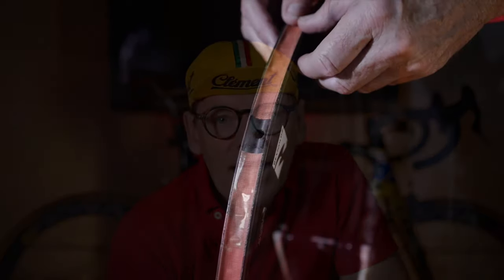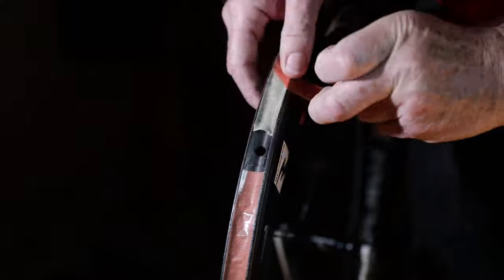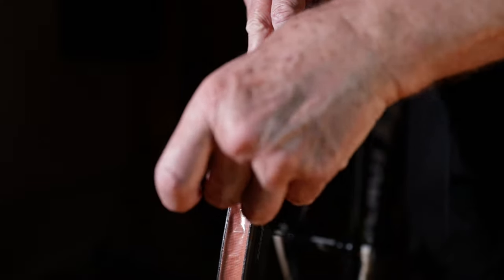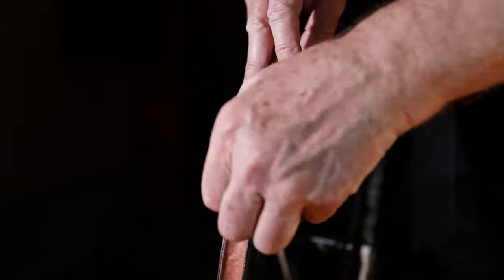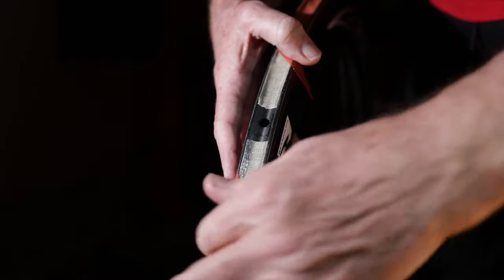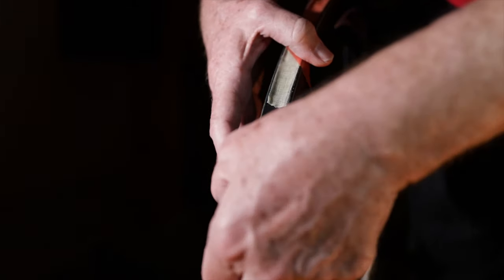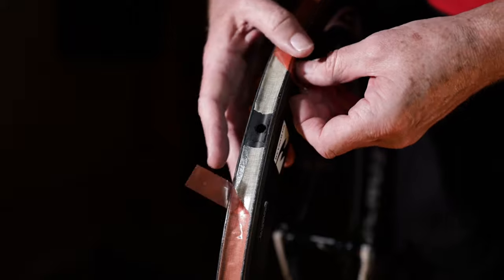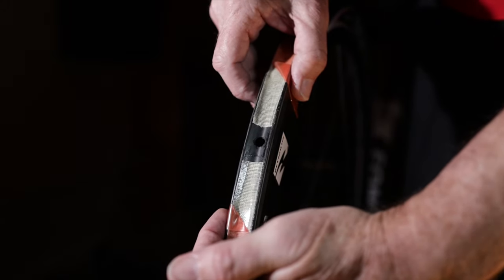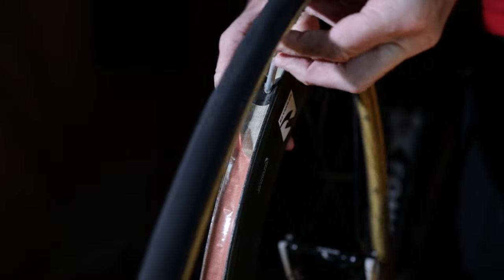Before rushing in to put the tire on, the first thing you need to do is get the ends of the top tape and fold them back. Get the two pieces on each side and fold them back 90 degrees. So when you insert the valve into the valve hole, there's a little bit of tape exposed so the actual tire can stick to the double-sided tape, but the rest of it is protected by the top tape. These little bits of tape sticking out each side can be pulled later to activate the tape and stick the tire on.